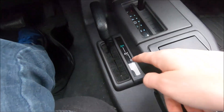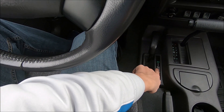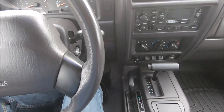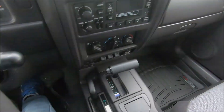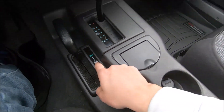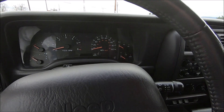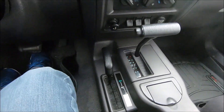Now when you're going off-roading or if the road surface is slippery and loose, that's when you can shift into four high. You want to be careful with the NP-231 because four high means four-wheel drive part-time. What that means is that the front and rear axles are going to be split evenly — 50% power to the front and 50% power to the rear. Whenever you shift into four-wheel drive high with the 231, a light will light up on the dash. It turns yellow and just says part-time — that's how you know you're in four-wheel drive.